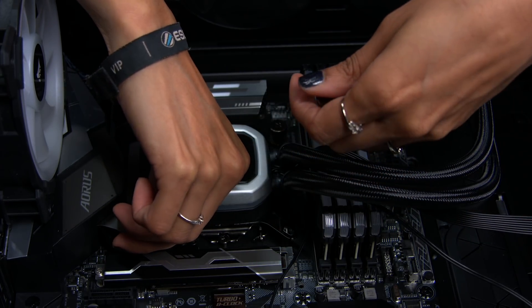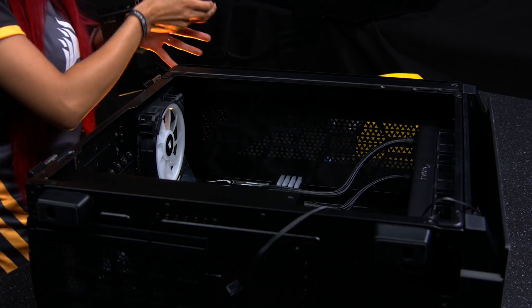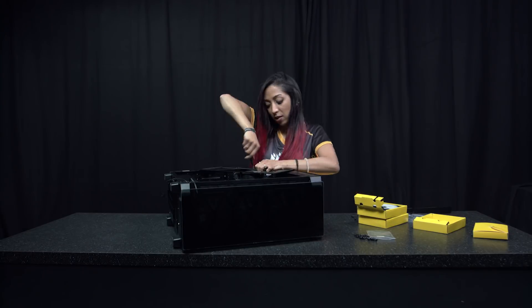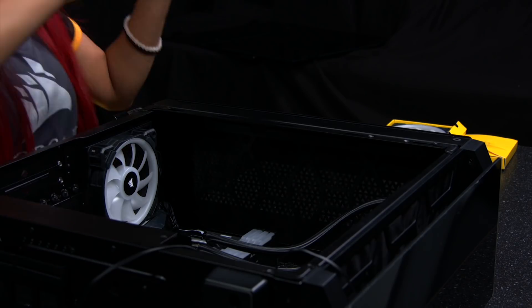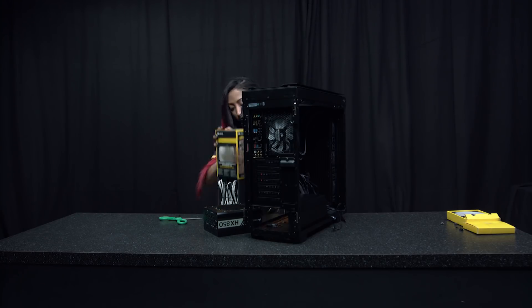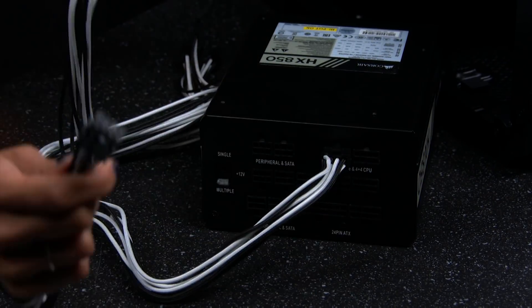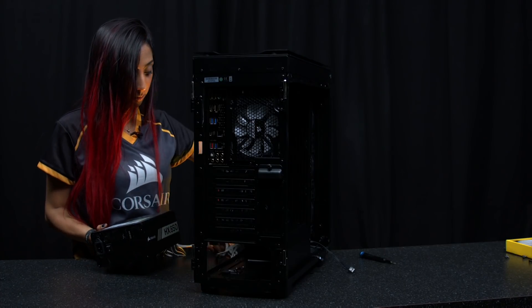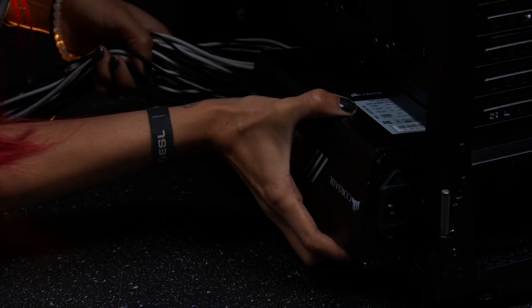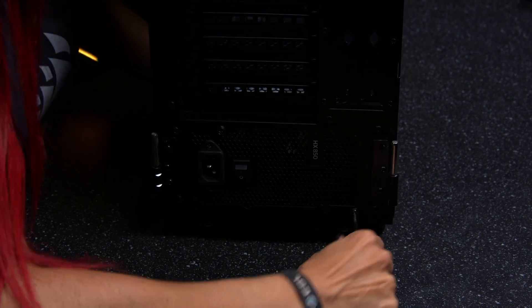Also, remember to make sure that you've connected your USB cable to your CPU cooler. Remove the top fan plate and attach the fans with the airflow pointing up and out of the top of the case, then slot the top plate back into the case with the fans attached. Insert the Corsair premium grade cables into the PSU, then insert the PSU into the case with the fan facing down, and screw the power supply unit into place at the back of the case.